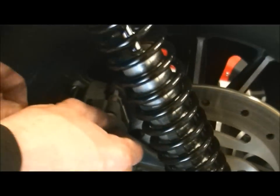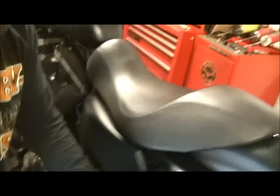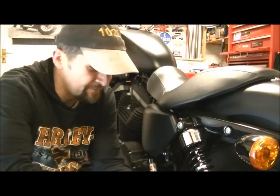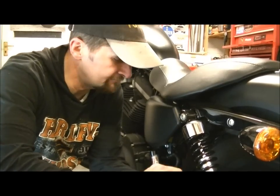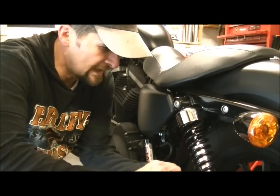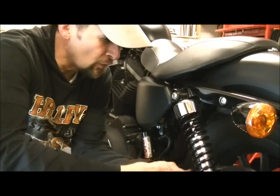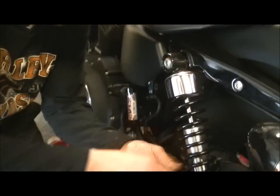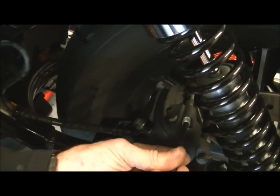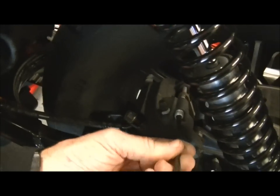Now these days there are more and more metric parts on your Harley, I'm afraid. As I said, the purists may not like it, but that's the way the manufacturer does it. So, 5mm Allen key. Withdraw the pin, it screws in this side, and in the back it just goes into an empty hole. There we go. And that's quite dusty and dry, which is pretty common.